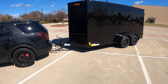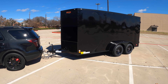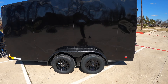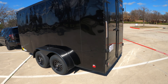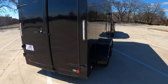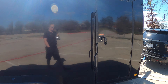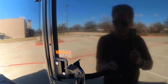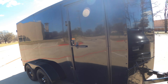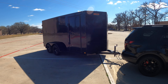If it was full of water, I'd really be pushing it with my Explorer — it's rated for 6,500 pounds. The important thing is that you have electric brakes. If you're going to tow it with one of those vehicles, you absolutely need electric brakes, because the vehicle would probably have just enough muscle to tow it, but stopping would be a big issue trying to get the thing to stop if it was full of water. Water weight is very heavy — it's basically going to double the weight of this trailer when it's full.